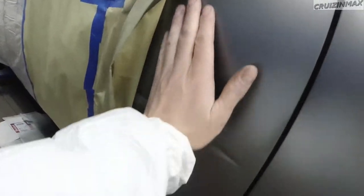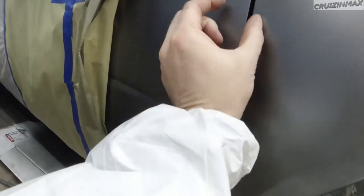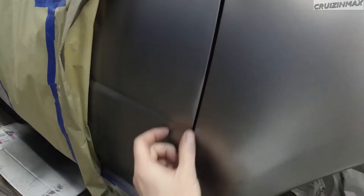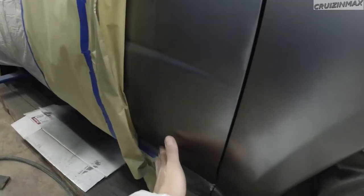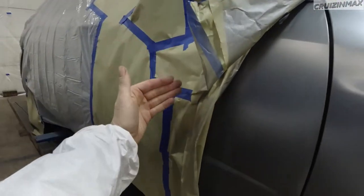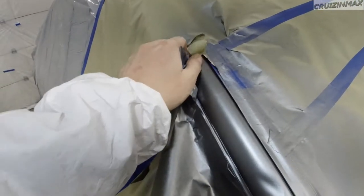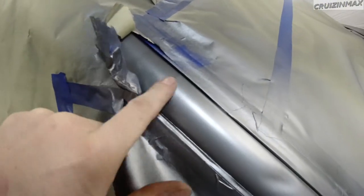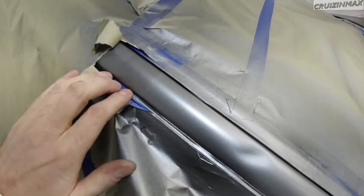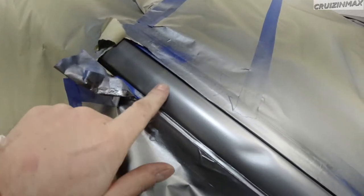We only had a limited area to paint. This is rough over here — we gotta sand this down. I'm gonna peel this back and tape it up again. Let's compare colors. You can see a line, but there's no ridge, so that's good news. We can lightly sand this, blend them together, and just put the clear coat here.